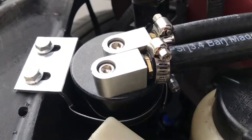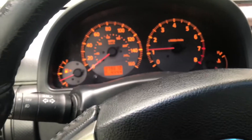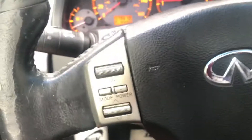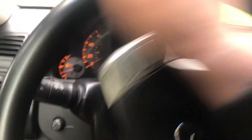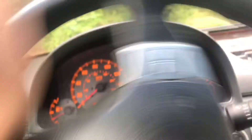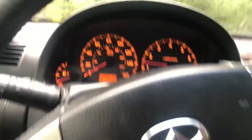What's up everybody, picking up the video. Today I've got to go get my test pipes installed and return this catch can. I thought I was putting it in wrong, but really it was letting air in and throwing engine check lights. So I just threw the factory PCV hose back in and ordered a new catch can that's supposed to come in tomorrow. I've used the other catch can before on my Neon with no issues, so hopefully the new one works.